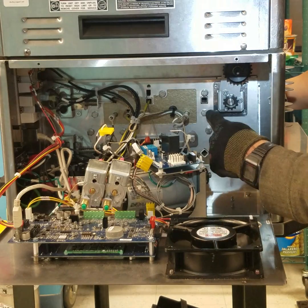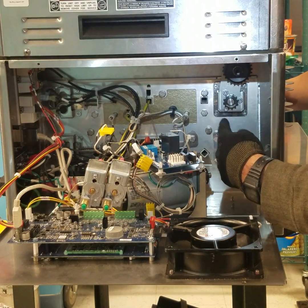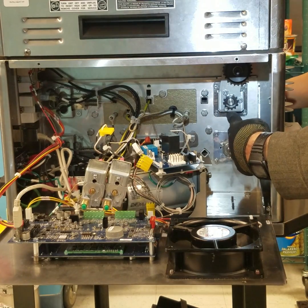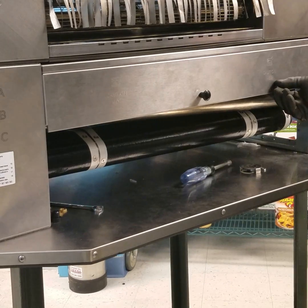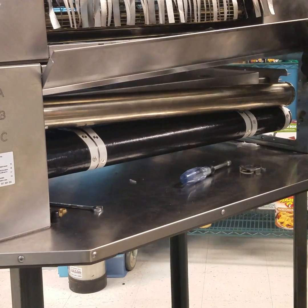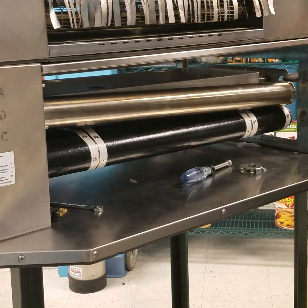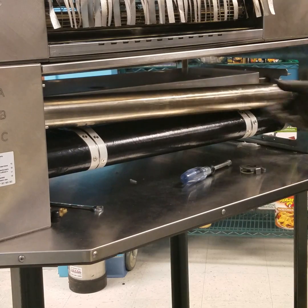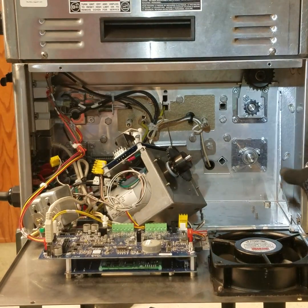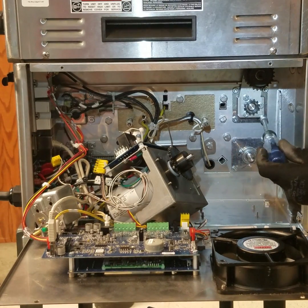Ensure the roller is flush with the firewall before you install the 4 hex nuts. Also confirm that these 2 hex nuts are vertically above and below one another as shown. Lift the front door. Locate the spring-loaded tab, pull it away to dislodge the door, set aside. Take the drive roller and ensure its position within the center of this frame so that it's straight across. While supporting the drive roller at the opposite end in position, install and tighten the 4 hex nuts.